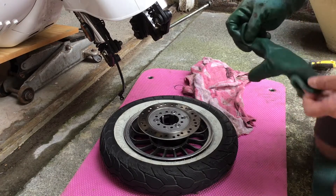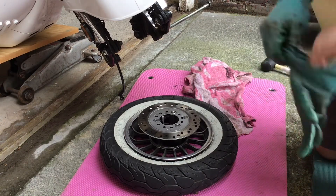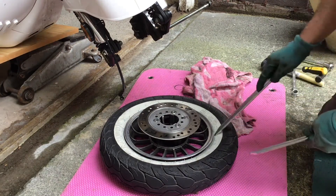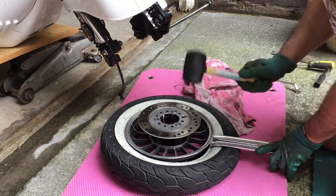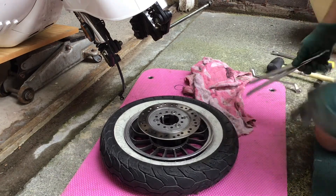I got really lucky there. I managed to break both sides of the tire bead by inserting a pair of tire levers, holding them down, and using my rubber hammer hitting it all the way around — it just popped off. So I was really lucky there.